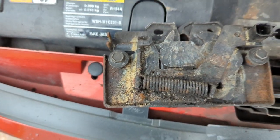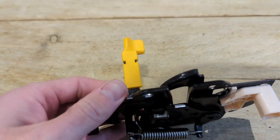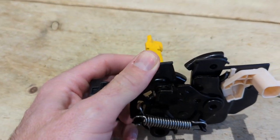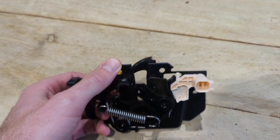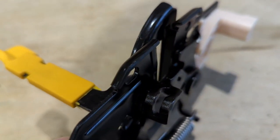A new catch is only about eleven quid, so I'll give it a try. As you can tell, it's a little bit damp out there this morning — the Fiesta bonnet catch, anyone? I just want to quickly show you the new catch before I put it on. It's quite straightforward. The catch itself has a similar mechanism — it's got the yellow tab on the back which is the secondary release, and as you pull that it opens up so you can actually release the bonnet.